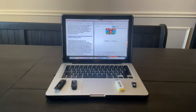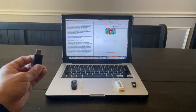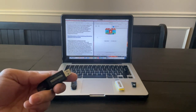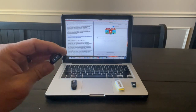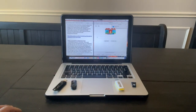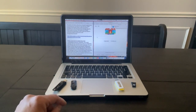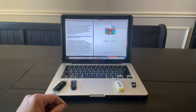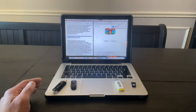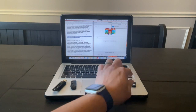Before we get started, I wanted to talk about some of the challenges that I was faced with. As you can see here, I've got several different USB flash drives: a 256 gig SanDisk USB 3.0, a 16 gig, an 8 gig, and an 8 gig. The instructions provided by White Auto and Media Services speak about saving this software onto a 2.0 USB flash drive with at least four gigs of storage. The actual download itself is two gigs. When I followed the instructions, I had difficulty getting this to work on all of these flash drives except for this one here on the far right.